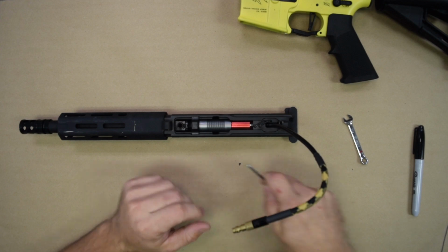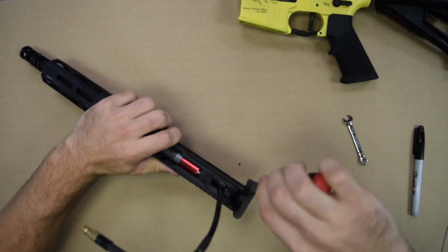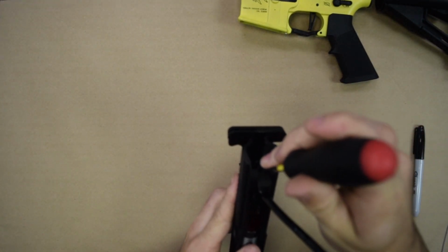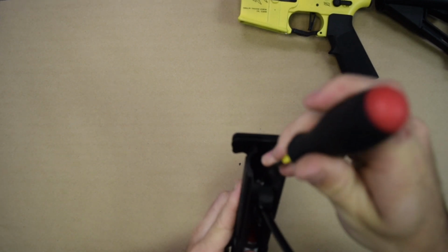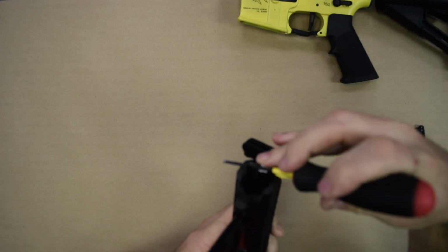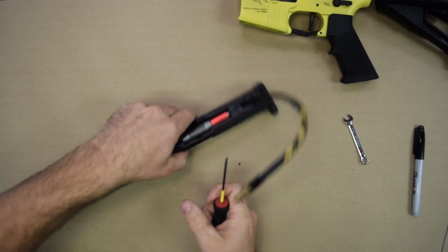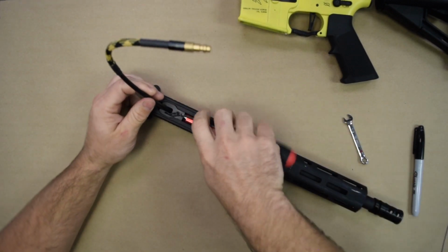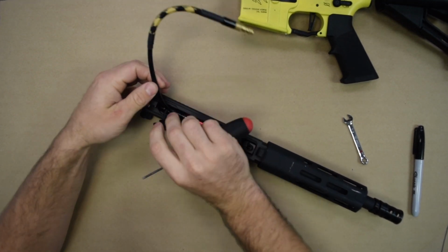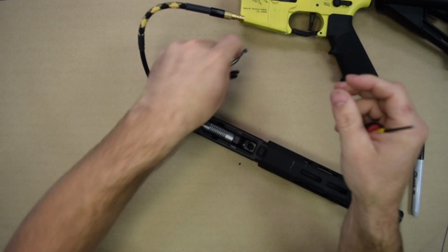So, to get started, first we are going to remove the wiring from the connection at the back of the solenoid. If you can see in here, what we're going to do is pop the connector out of the solenoid so we're free back there. Okay. Next, we're going to pop this back clip out. Again, if you get under this front edge, just pop it out there. And then you can gently pull out the wiring with your connector. Set that aside.